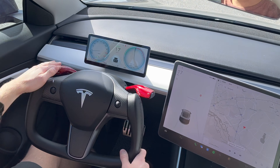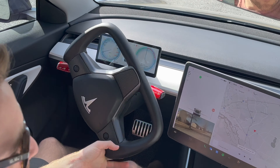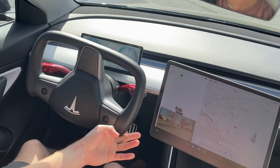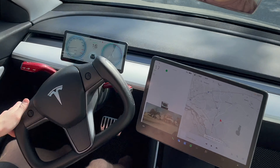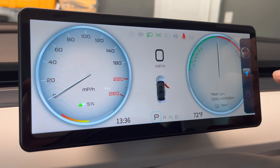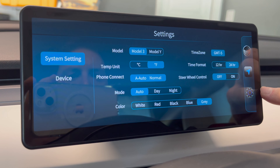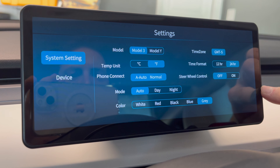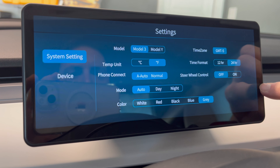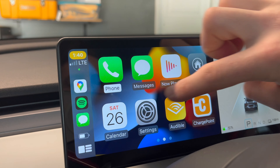That's it — we've finally reached the end of the install and we can see the screen mirrors what the main Tesla screen displays. Should your display show Celsius instead of Fahrenheit or the time is in the wrong time zone, there is a way to change these settings in the main menu display. On the right-hand side of the screen, just swipe your finger to the left and this will bring up a menu to select a gear wrench icon. When open, you can choose your preferred setting from the color of your car to the temperature unit along with many other settings.